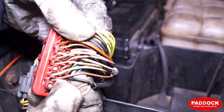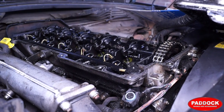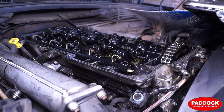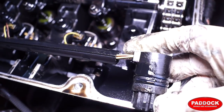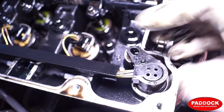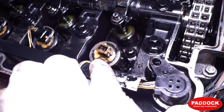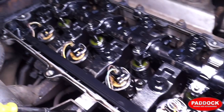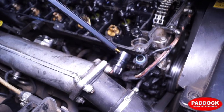It makes the job a lot less confusing if you have to repair any of these or trace faults. This part of the engine harness is available from Paddock Spares which will have the connector C0158, or the red plug. The loom itself is very easy to remove and replace once you have the rocker cover off. All we need to do is push out the connector — you can see that's rather oily. Then we have the connectors to the injectors. These are PD pump duse injectors — the connectors come off and you have two pins on each. Just disconnect them and get the loom out of the way including the plug.